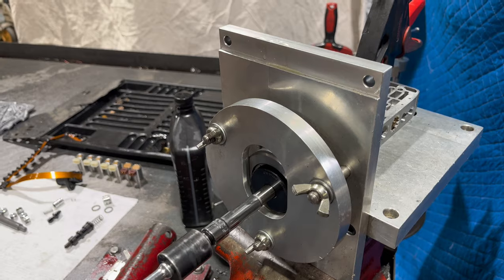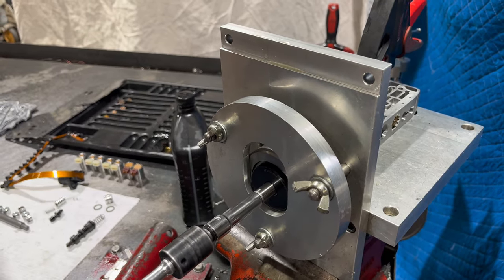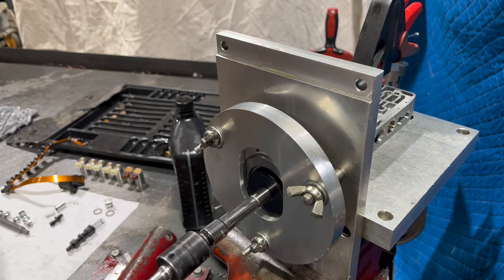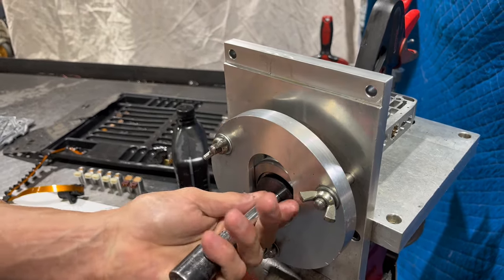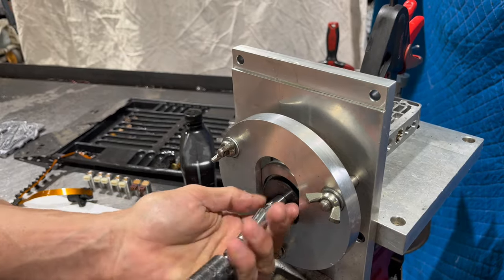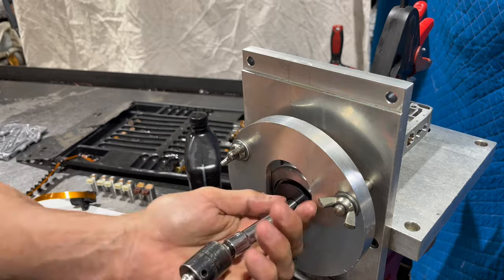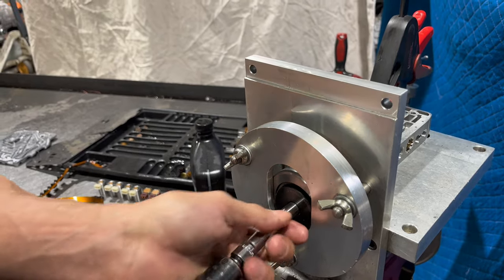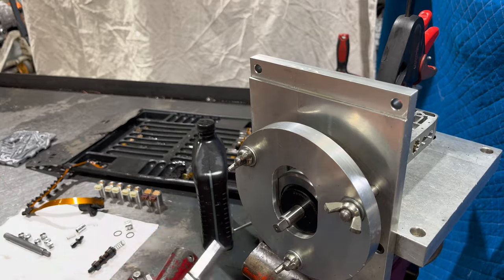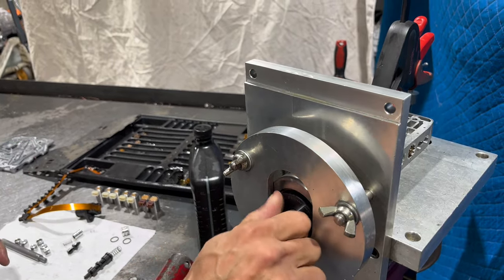But this pretty much isn't a do-it-yourself thing. If you have one of these that's bad you're better off getting a replacement valve body, because this is hundreds and hundreds of dollars worth of tools to do this. And reamers — you always want to keep turning them in the same direction. If you go backwards with this thing you're going to ruin the bore and you're also going to ruin the reamer.